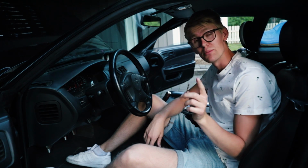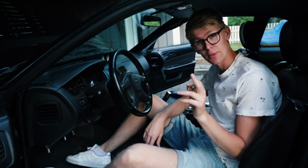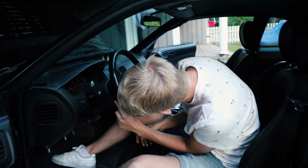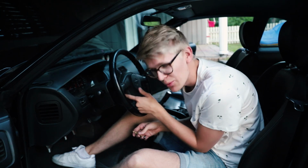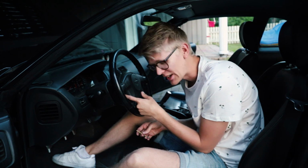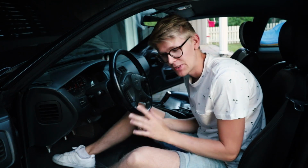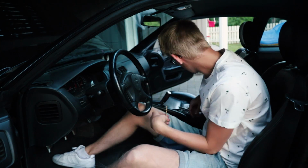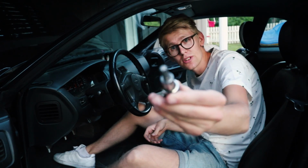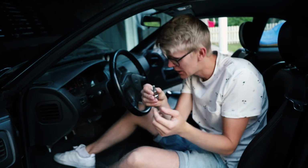First, you need to disconnect your battery, your ground pole, negative pole, whatever. Disconnect your battery, and then you need to take off the covers you have right behind here on the steering wheel. And here it's actually a really bad, strange Torx bolt. It's a 50 Torx. That sucks. It has a safety feature inside, so you can't use your regular Torx because you need a hole in it. I don't have that, so we have to break it off.